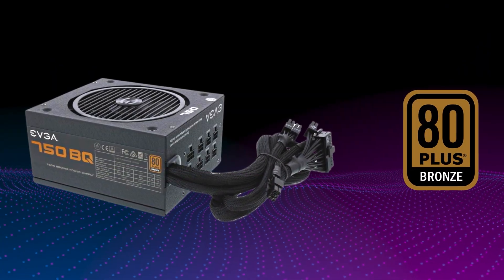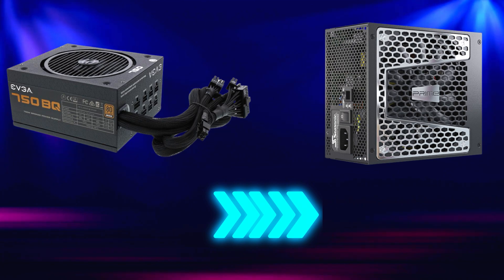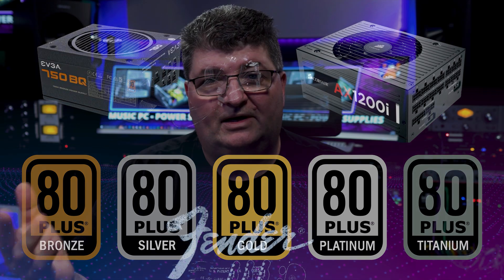At that point, I started going through the differences in power supplies and found out there's a lot more to it. I ended up upgrading from an EVGA 750BQ, which I thought was a decent enough power supply — only an 80 plus bronze, but I was happy with that efficiency, and EVGA was a reputable manufacturer. By the time I was done, I upgraded to a Seasonic GX1000 — arguably more wattage, 80 plus gold. I thought if I go with gold, it'll be more efficient, there'll be less heat buildup, the fan won't run as much, so at least I'd have less noise in my studio. But should I go with gold, platinum, or titanium, and how many watts did I really need?